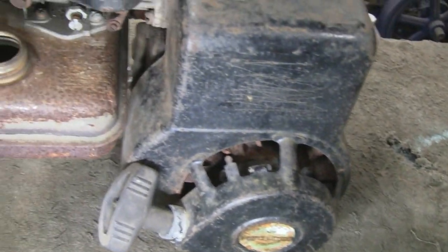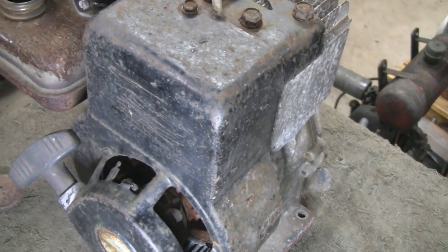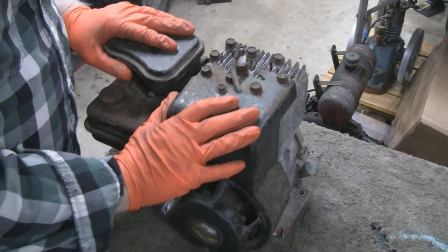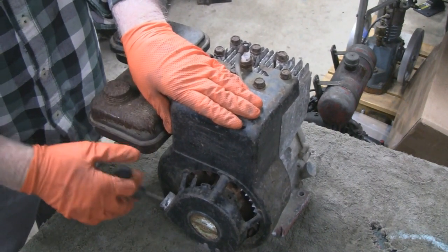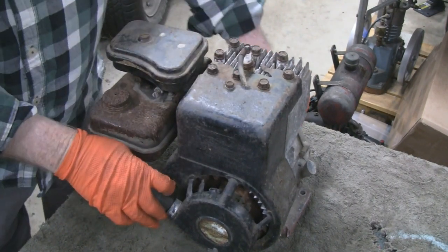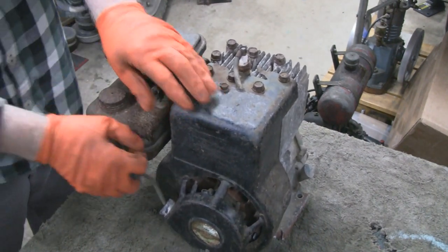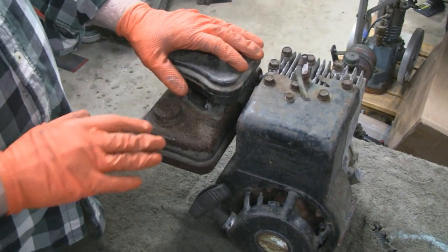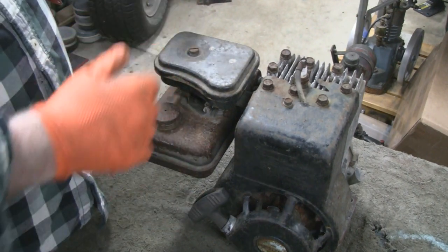It's not even seized. As a matter of fact, I think it might have a stuck valve because it spins too easy. But the more I dig around with it, you can actually hear compression. The problem there is just the balls in the detent to start it are probably sticky. The valve got unstuck just from twisting and moving it. This engine was sitting in our buddy Bill's yard, and chances are it would sit there until he died and then everybody would throw it in a dumpster.